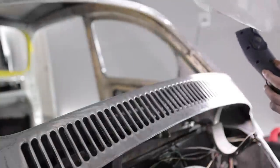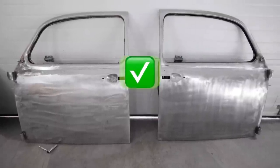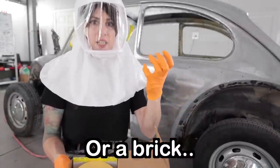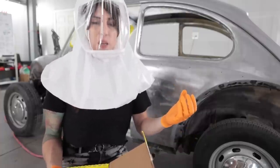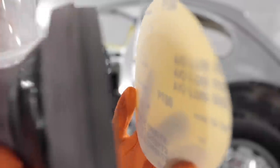I think I got it all. Fred just finished up the last work, so all that stuff is taken care of. Now I have to sand everything in 180 grit — you can also use 150 grit. You need to create some tooth in the metal, because if you just spray epoxy over bare metal you'd have chemical adhesion but not mechanical adhesion. I'm probably going to use about half a box of these sanding discs.